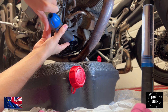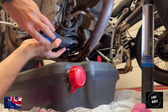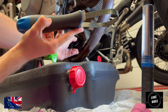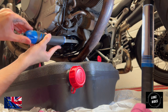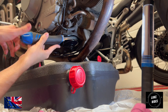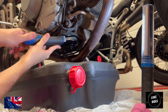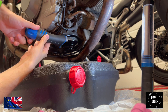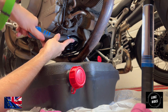The reason you're doing this is that K&N fit that particular nut on the filter, but that nut is designed for taking the oil filter off more easily. It's not actually designed to take the force of a socket and torque the filter down. That's why you fit it by hand with a special tool — you have to use this tool to get some grip on the filter.